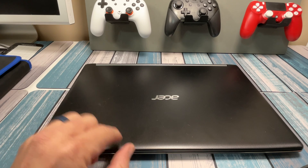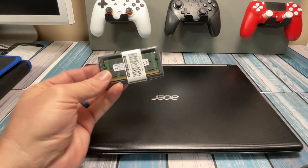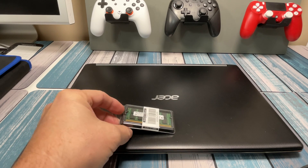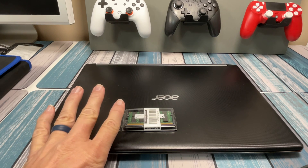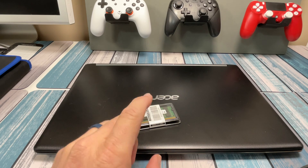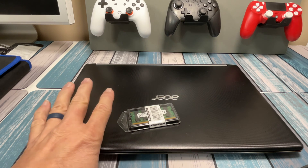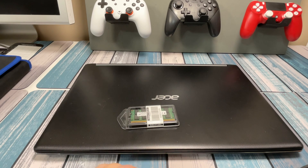Now this has 8 gigs of RAM in it, but unfortunately 4 gigs is built into the computer itself and 4 gigs is a chip you can actually remove. So we're going to take that second chip out and replace it with a 16-gig chip — DDR4 2400MHz. That's going to give us essentially 20 gigs of RAM. It's going to give us basically 8 gigs of dual-channel: the 4 that's built in addressing another 4 from this chip in dual-channel mode, and the additional 12 on here in single-channel mode. I did my best to match up the specs of this RAM to what's believed to be soldered into the board, so hopefully everything works.